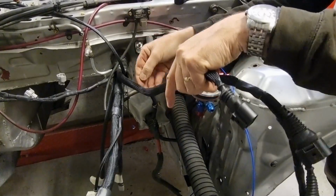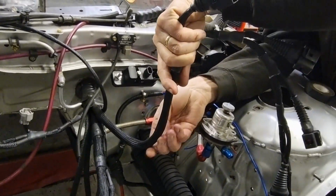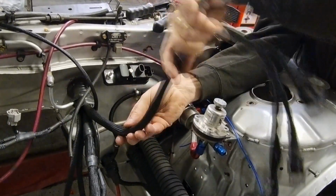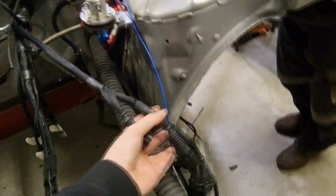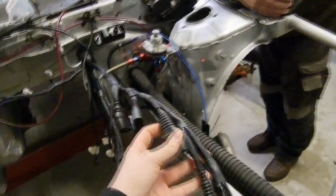As well as that, if you have a bunch of cables and you bend them, you put strain on them, and you'll be kinking the ones on the inside. With this, because they're wound around, there's no strain. So it's kind of strain relief, really. I suppose the con is how long it takes, because it probably took you a week. And it was your first time doing it too, so you had to figure it out as you went along. If you're doing these all the time, you'll have a much quicker way of doing it.